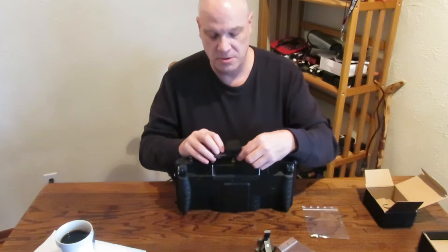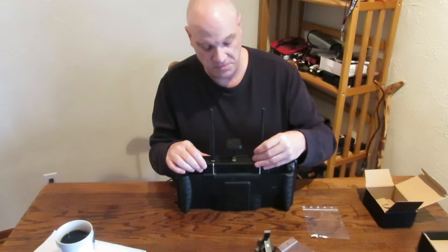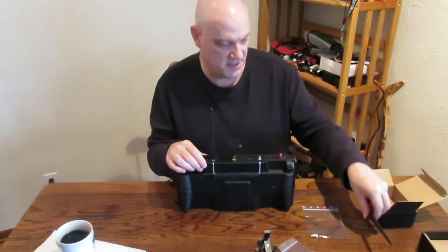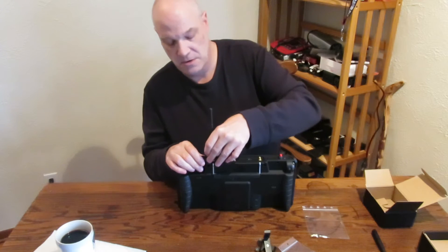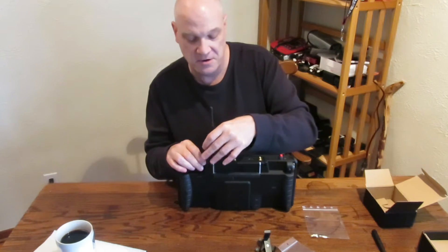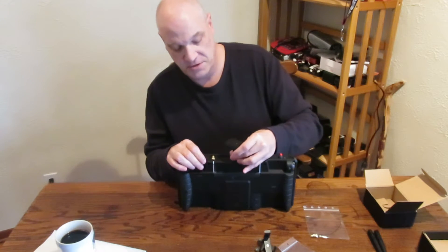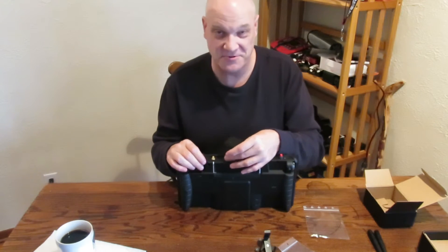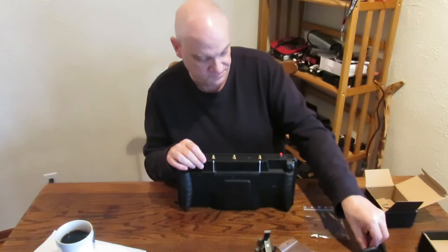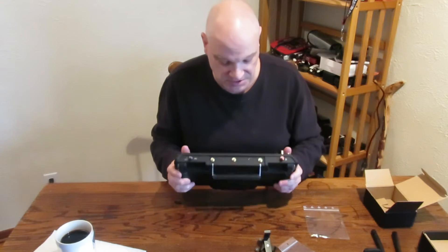What we're going to do is open these up. The first thing is to remove the existing antennas. Please never turn your ST16 on without having your antennas installed — it does really bad things to the transmitters. So while we're doing this, it will remain in the off position.